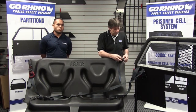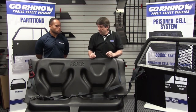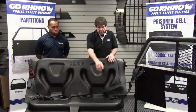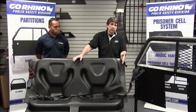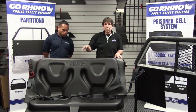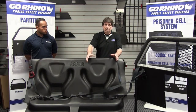If we're doing a center belt, this buckle is going to go up where the center hoop goes, and we're going to put all the hardware back in place just like we took it apart, except we're replacing the shoulder hoop with a buckle and strap. From there, with the seat nestled in and the seat belt protruding up through, get the front two bolts started but don't tighten them all the way. The rest of the seat should nestle against the C-pillar trim. Push in the back and use the provided self-tapping screws — about three, centered, two to three inches from the outside — to fasten it to the seat stand. Then come back, make sure everything's tight, and tighten the front two bolts. They just need to be good and snug; all they're doing is holding the seat in position.